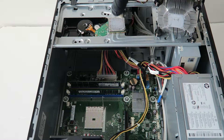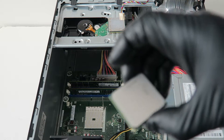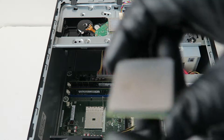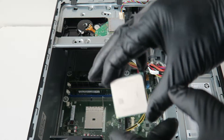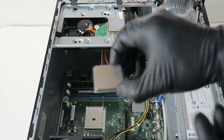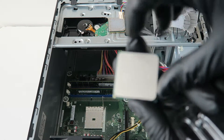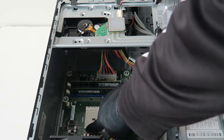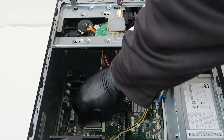I'm going to be upgrading to an A6 processor, the 3620 — it's a quad-core. To install the processor, see the gold corner right there? The gold corner is going to go over here like this — the left bottom corner. The same way you remove it, it goes in like this, and the gold corner of the APU installs right there.